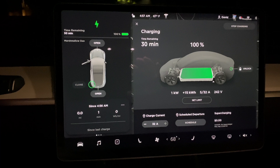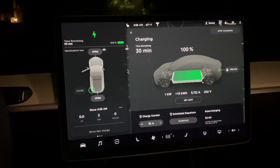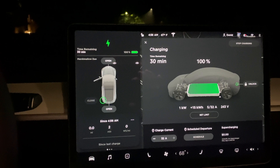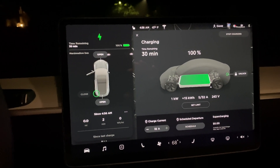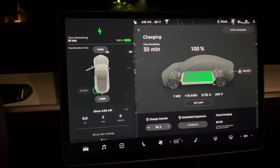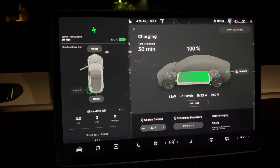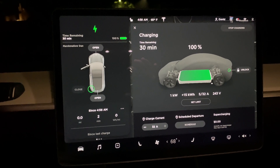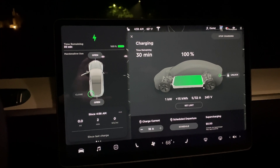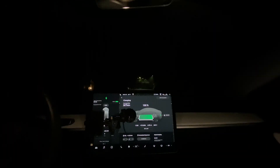We'll see how many miles we can get out of a full charge. This is a Standard Range Plus, rated for 240 miles — all electric of course. It does have almost 28,000 miles on it, so it's not new. It's just over a year old and I do believe there is some battery degradation — it's hard to tell how much. Maybe going up to 100% and then going down to a lower amount might kind of refresh the battery management system to see how much usable range there actually is in the pack left. We will test it out today — hopefully it's close to 240 miles. I'm guessing it's going to be more like 220 miles total.